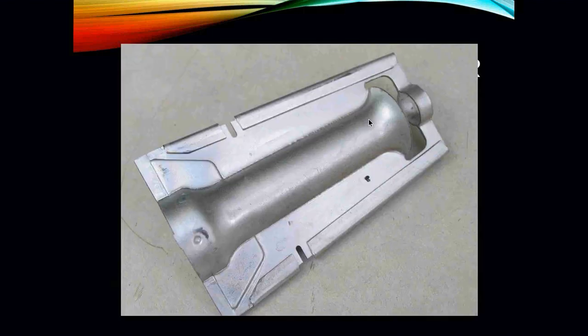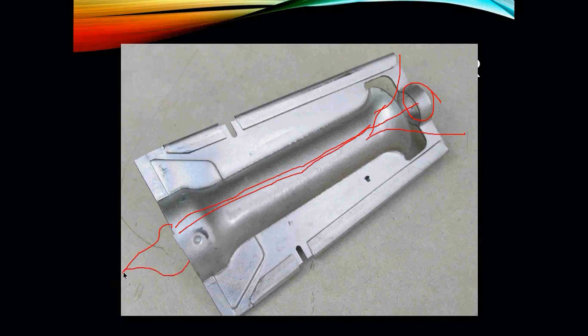And that's what the in-shot burner looks like. Your orifice would be sitting right in this little circle right here, which will introduce gas right down the center of our burner and out the other side, while also sucking in your primary air to create that air-to-fuel mixture, which is carried all the way down to the end of the burner where your ignition actually occurs and the flame comes out.